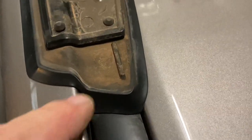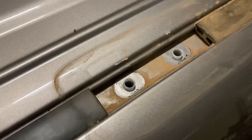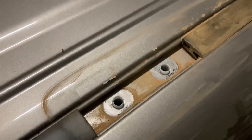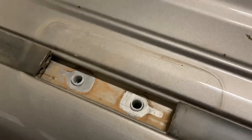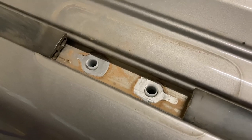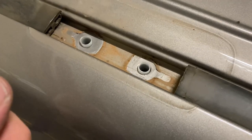Now that we've got these off — there's rubber underneath to help seal it up, but don't rely on it because dirt and water does get underneath. They look like 12 mil to me — zip those out. The one in the middle, just take that bolt out and once it's off you can remove that last bracket. We've got the rails off. If you've been on some outback trips and you clean your car properly it'll probably look something like this — you know, this sort of look. If you don't clean it, it'll be even fuller with dirt. The procedure is: compressed air — blow out any loose debris now.